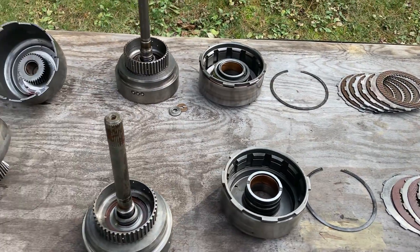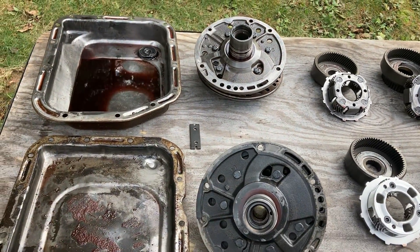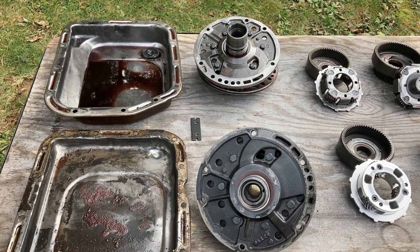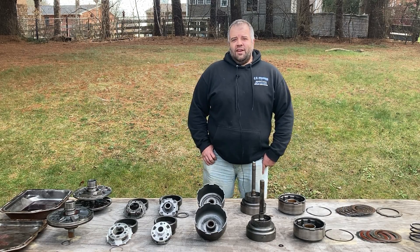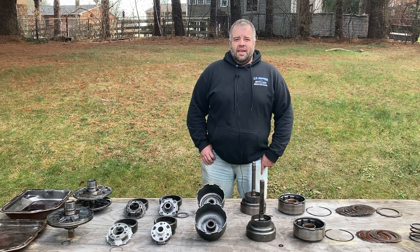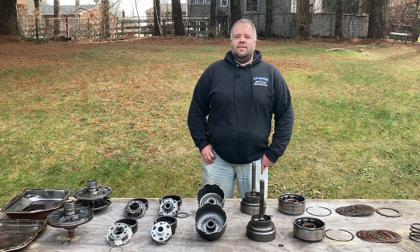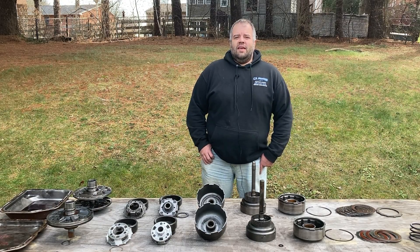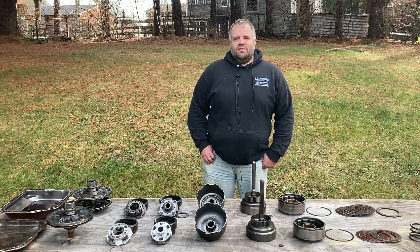There are several good reasons why we want to use some of the guts from an overdrive transmission, and they can be had cheap. If you like to build transmissions, that's one I can recommend picking up. So what do you guys think? Should we go standard gear ratio or should we go with the wide ratios? I can make a case for either. The standard ratios have aluminum carriers — lightweight, low drag, keeping with the Plan Z Dart philosophy. Or we can go with the wide ratios: they're a little heavier, but it'll make the car leave with a lot more gear ratio and get it moving quicker, sooner. It'll help overcome the fact that the rear end doesn't have enough gear in it for that application. Let me know in the comments — I'm anxious to see what you have to say.